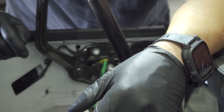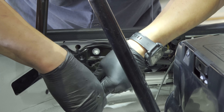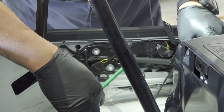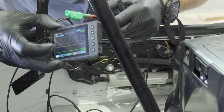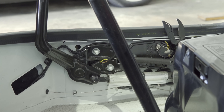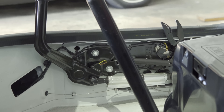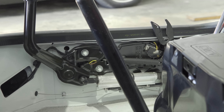So that means our brown wire is the signal wire — service information is inaccurate. We have a harness issue. I'm going to go back to our suspect sensor and see what we saw there, because it's kind of easier now that we know our equipment is 100% good. Mind you, this is the first time I've ever touched one of these convertible systems on a BMW, so please bear with me.